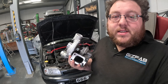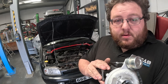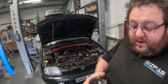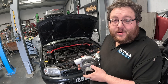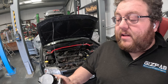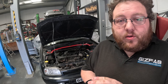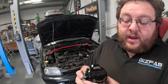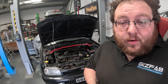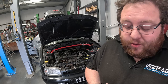This is a Garrett GT20. On paper it's a better turbo than the GBC series — it should spool a bit quicker but also carry power further into the rev range. It's also a nice compact unit, which helps when packaging the turbo into the engine bay. As well as the turbocharger, we're going to be using a GFB EX38 for ultimate boost control. This is a bit overkill, but Thomas does want a bit of scream and noise on boost, and the only real way to do that is with an external wastegate. Plus we want to go all out on this build, and it makes sense to have some more shiny products in the engine bay.